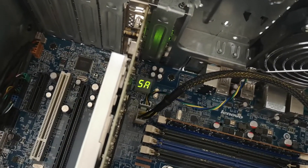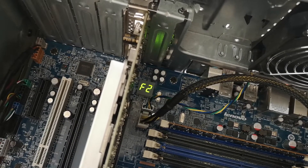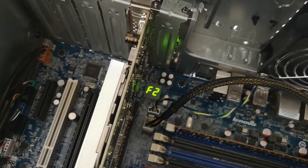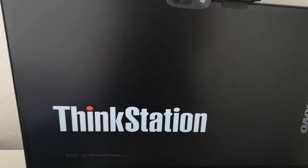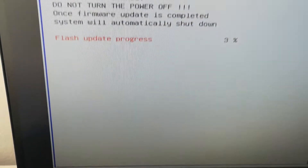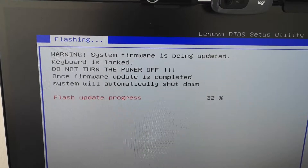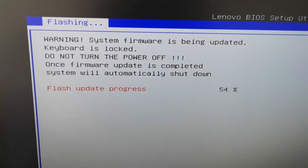Let's switch on. There's the display of motherboard checking codes on a good old 7-segment display. Double beep — that means it's in CMOS reset mode. Now I'm waiting for something to come up on the screen. There is life! Before the USB stick was in, there was a black screen. Now we have 'BIOS is recovering' — an interesting version of English. Firmware is being updated. Flash in progress. It looks like it's working, and the BIOS is being flashed with the version from the USB stick.